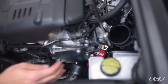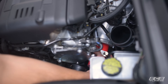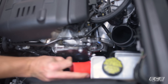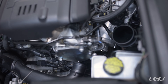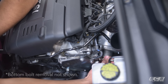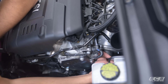Next step is to remove the remaining T-bolt clamp and then pull the turbo coupler off. That right there is your turbo muffler that we're going to be replacing. The turbo muffler is held on with three bolts — these are where you use your 4 millimeter Allen. They're not exactly the easiest to get to, so you might need to use a variety of extensions.